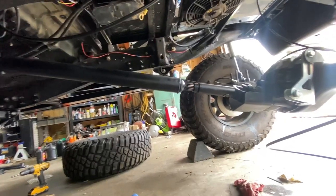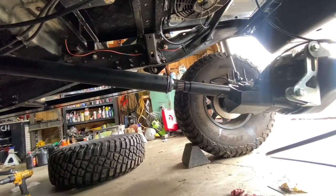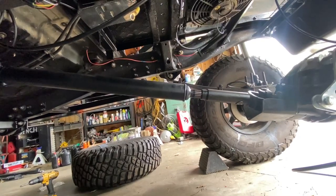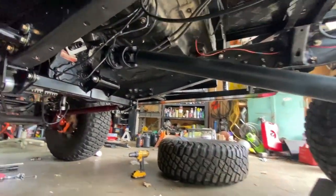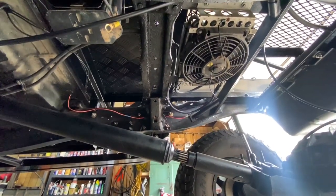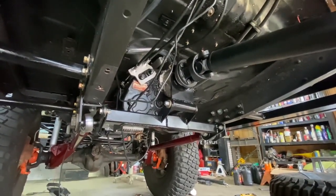48 hours later — there's the rear driveshaft, all shortened up and bolted in. Length worked out perfectly. It'll be another day or so before I can pick up the front shaft. This lets me go ahead and address the anti-wrap bar — I'll probably pick that up in the next video. I'm going to have to remount the cross member and probably shorten the anti-wrap bar since I lengthened it originally. Transmission cooler lines are all plumbed, P-clamped up to the floor. Lines are routed and everything is away from any heat sources. Very happy — turned out really good under here.